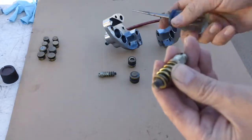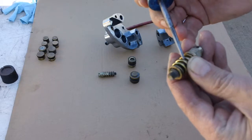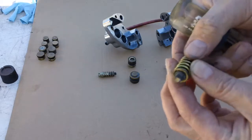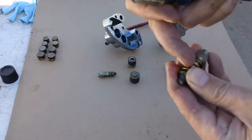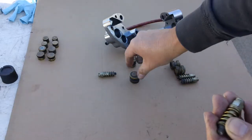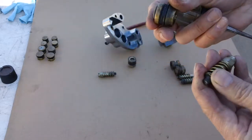The springs screw through the caliper through a through-hole and go into the brake pad — the spring pulls the pad back. As it pulls the pad back, the spring pressure is also applied to the caliper piston, and that retracts the whole system.